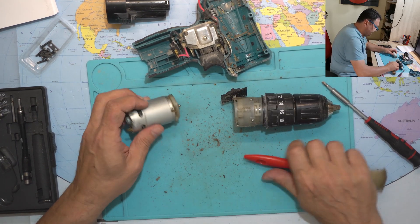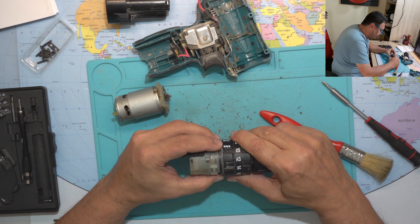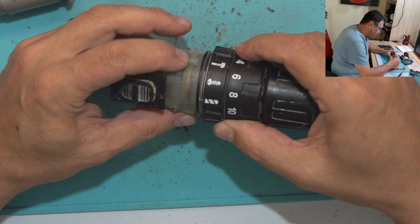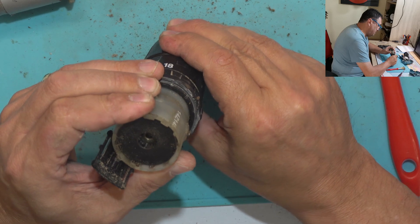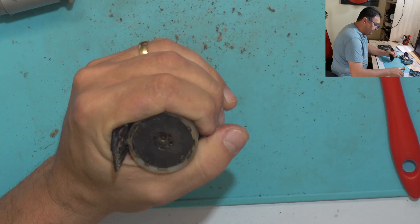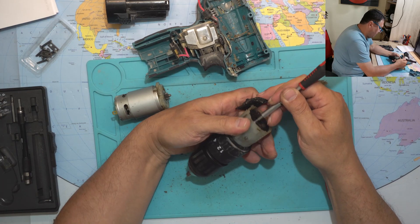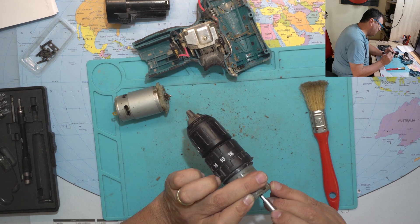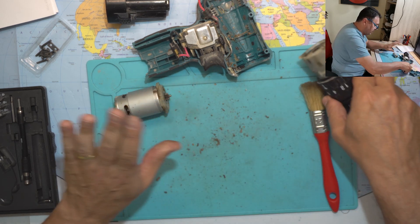It's moving. This here is the planetary gear reduction system. I need to take this out — there should be a screw somewhere, and it's crazy hard. Look there — it's moving somehow. Now look: it's not blocked, and this is very nice. You see, spinning this goes straight through. Beautiful. So we don't have anything mechanical — everything points to an electrical issue.